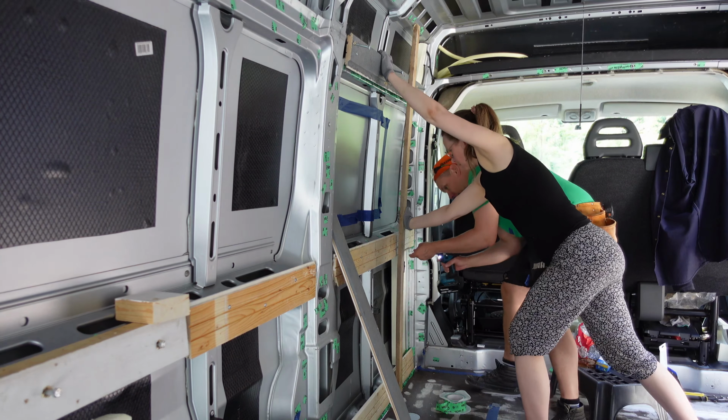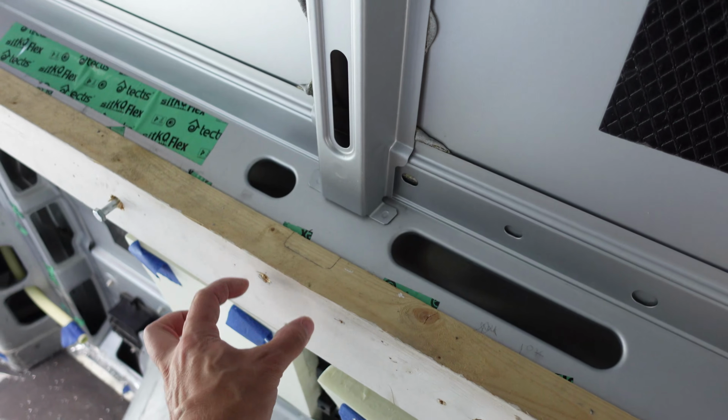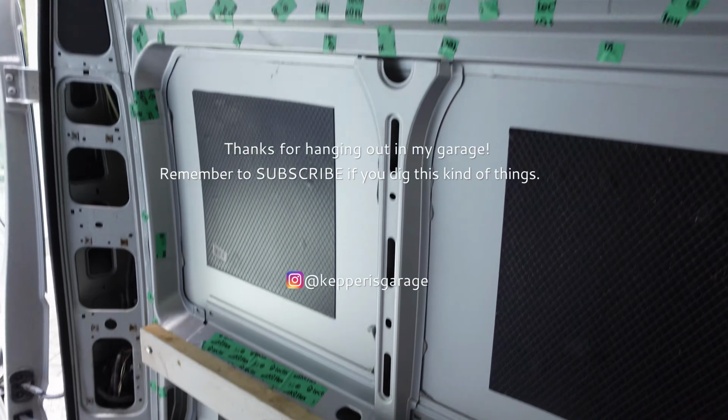These are 2 centimeters, this is 5 centimeters, so we carve out a small piece here so we can attach the vertical one also here, and it will follow the shape nicely.